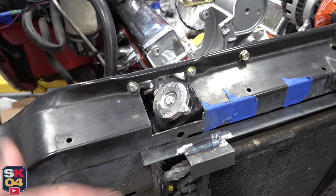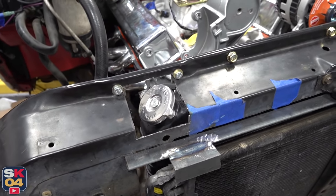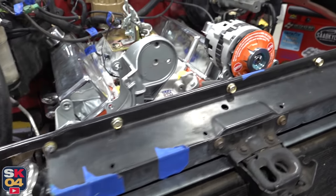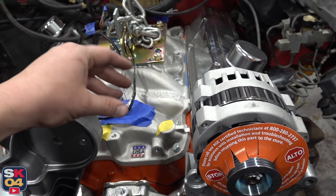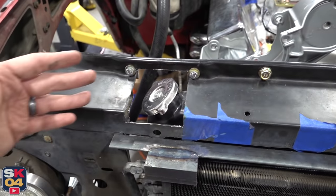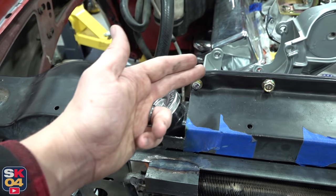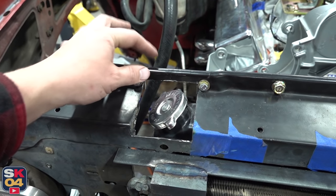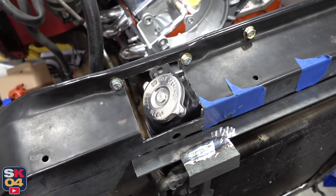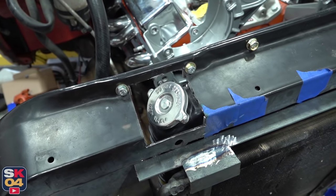Real quick — as you saw, I did cut a hole in the core support for the radiator cap. I didn't really see another option right off. I have seen other options like inline filler necks that you could put in the radiator hose, and there are thermostat housings that have a fill setup on them, but they're a little expensive, so this was my kind of budget get-it-done type deal. I also added an extra piece of metal back there that I bolted in just to give this piece a little bit of extra thickness, and it still feels really strong. I'll be cleaning these edges up so they're not quite so sharp, but it's just enough space to get in there and work that cap.